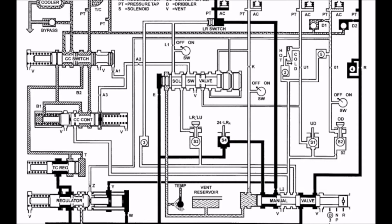This is used to make a very strong apply going into the reverse gear to avoid clutch slippage and also allow for a very firm driveway shift to avoid damaging the transmission.